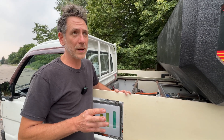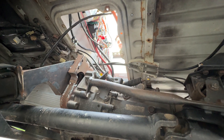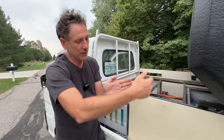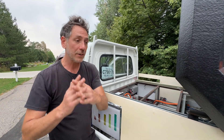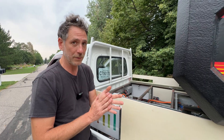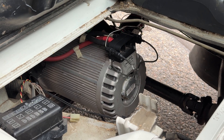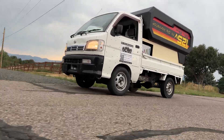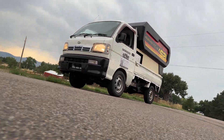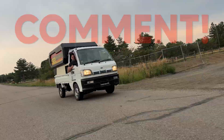The adapter plate is not a normal setup. Usually it's a billet piece of aluminum, but in this case it's flat plate that has been matched — four sides, tongue-and-groove, tab-and-slot connected together. You can do this if you know your B-face pattern for your Hyper 9 and your transmission bell housing pattern. Put them both on one face, order two of them from SendCutSend, do it all in CAD, and weld them together. You don't have to worry about jigging because of the tab and slot. Very cheap — maybe $150 total.